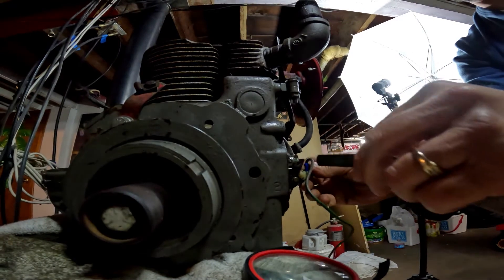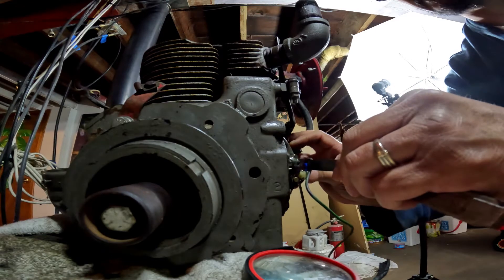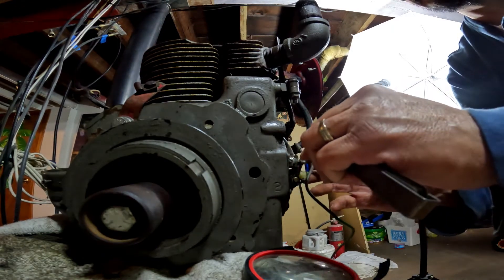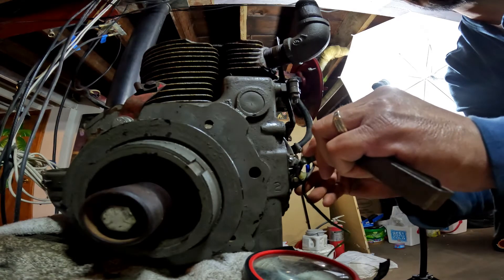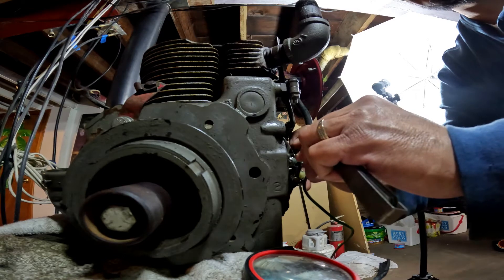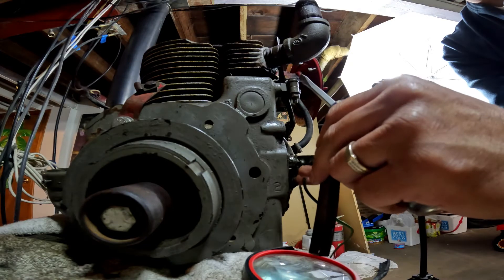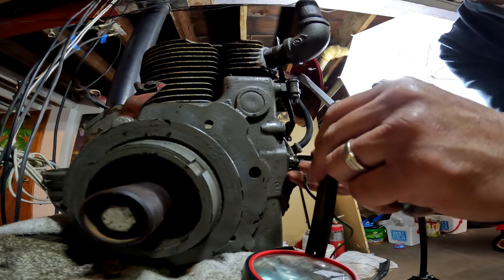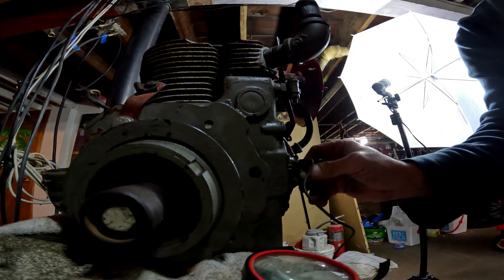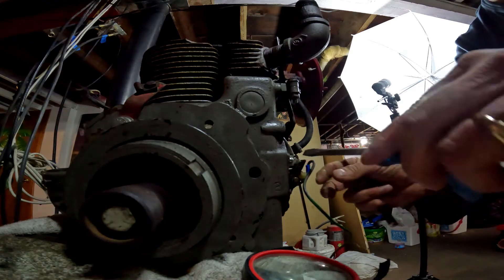Put that down right there. Got this all the way in right here — you don't want to push it open yourself. Then you put your points back in there — I mean your gap. Your point-20 gap is in there. With your point-20 gap, make sure it's at point-20. See, this whole thing moves out once you take that screw off. You kind of want to set it back in there, and then you gap it.